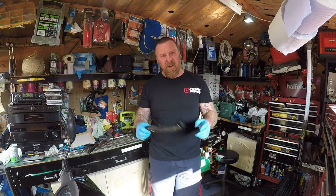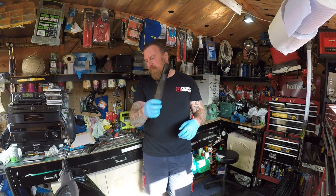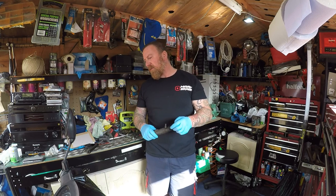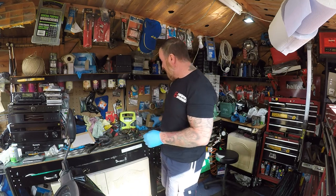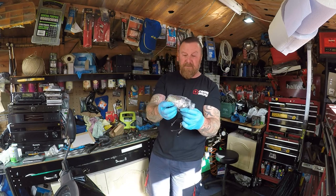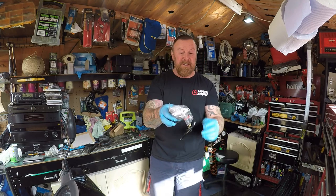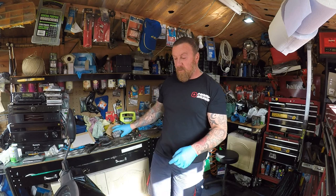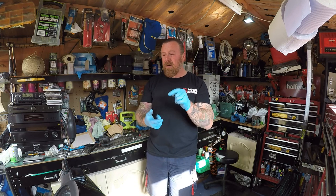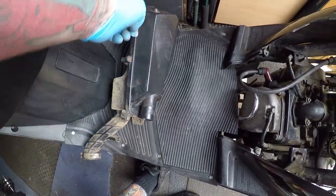This is going to be a bit of a long video and I'll cut out little bits. Let's get the seat up — that's just four screws. I'll show you where the air and petrol mix, then we're going to tune this. I want to get the side off. I think I want to investigate the starter motor first. This did take five days to arrive — I actually sold the bike before it even came — but I'm going to fit this today, brand spanking new one, because the wire on the old one comes out and it could be shorting. It's just two bolts. Let's get on with it: starter motor, check the relay, charge the battery, check the Bendix, show where the rollers are, carburetor.